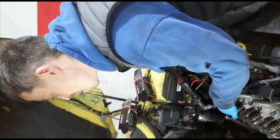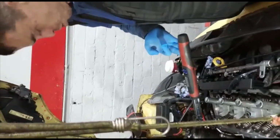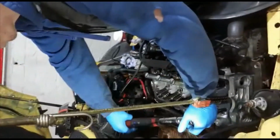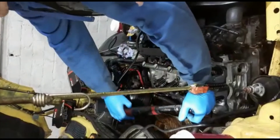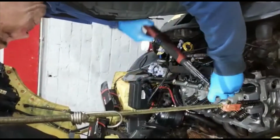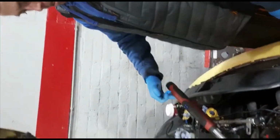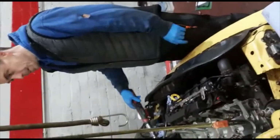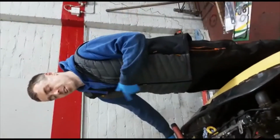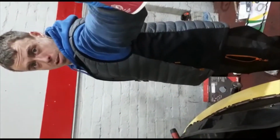So that's number 8, 9, 10. Make sure it's on 10. So again, try and get it running in one swoop. There's a 20. Number 9 now. So that's the first stage on those. The next stage is 40 newton meters, so double what we did there. And then another stage of 90 degrees, so that much. Quarter to, that's what you think of if you're 90 degrees.